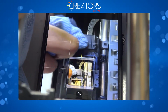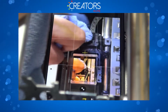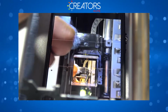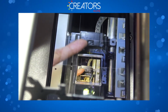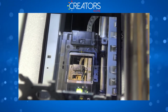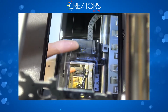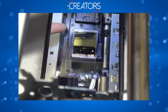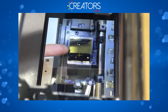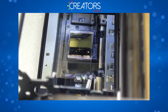Now from there, we're gonna move on to this part. This one is really nice and clean, but over time you will get lots of gunk accumulated right there, and you definitely want to get rid of it. The reason you want to clean this part is that if you don't, ink will accumulate here. It will become so thick that it will end up touching your garment. The carriage is going to be moving left to right, printing, and as soon as this built-up gunk touches your garment, if it's moving that way, guess what? All that gunk is going to roll. It's going to end up underneath your mirror plate, clogging all your nozzles, and game over. Be ready to spend $1,300 on a brand new print head. So there you go.